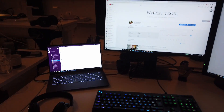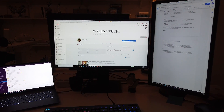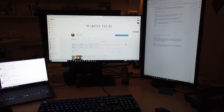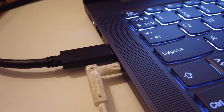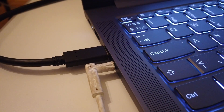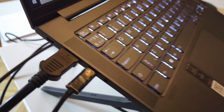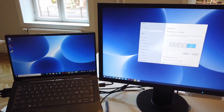However, the way that I am working normally in my office setup is with one quad HD monitor and then another full HD monitor in portrait mode next to it. For this I need the possibility to either daisy chain through one USB-C port to DisplayPort to the first monitor and then onwards with another DisplayPort to the second one, or to drive one monitor with one output and then use the other output for the other monitor.